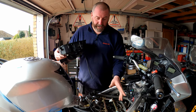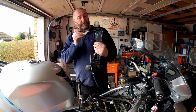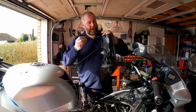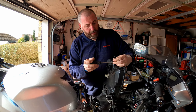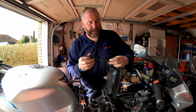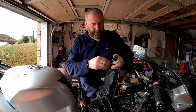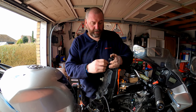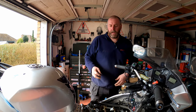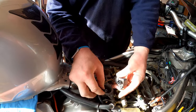Because we will need to start the bike shortly, I don't want vacuum leaking out. With the lower airbox, however, the MAP sensor does need to be removed and refitted with the vacuum maintained. The bike will run like an absolute dog without this one connected and doing its job — the ECU needs to see it and will make adjustments accordingly. So I'll remove it from the airbox, put the screw back so I don't lose it, and then this simply needs to be reconnected back to its connector and then the vacuum line reconnected.